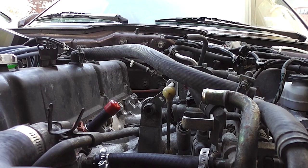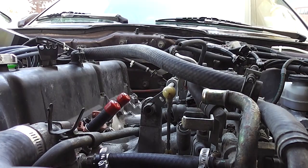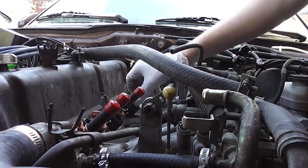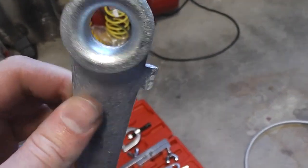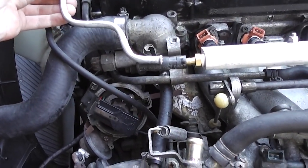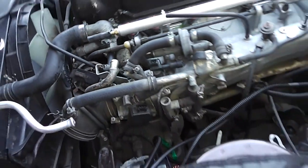Let's get these injectors in. Using a flare tool and a small handheld pipe bending tool — which broke just from the force of my hands — I've got my first hard line kind of mocked up. This is the one that will wrap around the head and sit right like this once it's in, very close to how it was stock, which is exactly what I want.